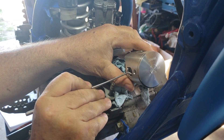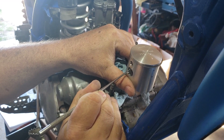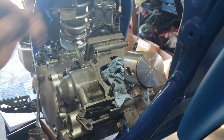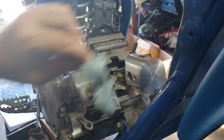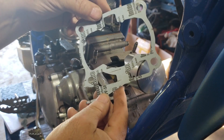Just look around and gently check to make sure the c-clip is actually seated all the way, because sometimes the end of it won't seat fully. Once it's in, you can go ahead and get rid of the rags in the engine because nothing small is going to fall down inside anymore.